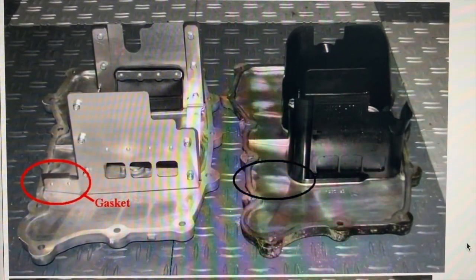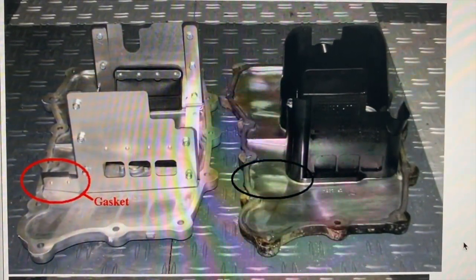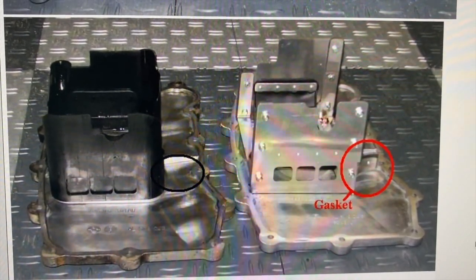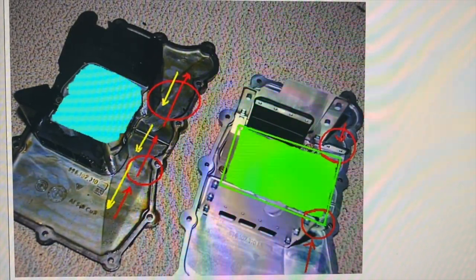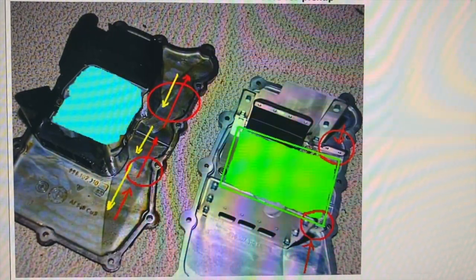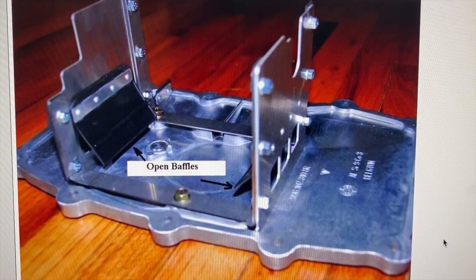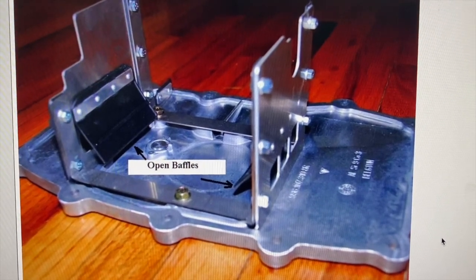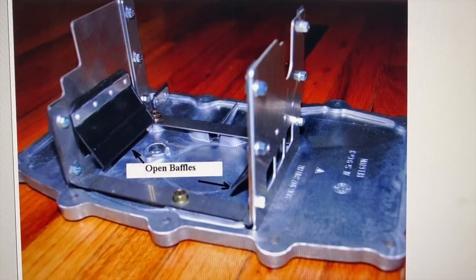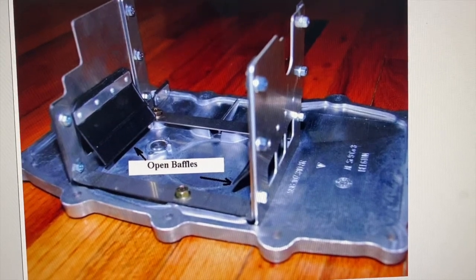Let's take a more detailed look at the differences and why you might want the X51. The X51 has small upright gaskets that the stock one does not have. When you put the pan on, these seal up with the engine block and prevent oil from flowing around the baffles. This effectively creates a little pocket of oil that remains close to the oil pickup, since it can only flow through the baffle openings. The baffles stay open so that oil from the returns can flow into the baffle interior, but lateral Gs causing backflow will slightly close them, keeping oil inside the pocket. With all of these things combined, there is a larger quantity of oil at the pickup that will stay near the oil pickup longer under cornering. So although a complete oil scavenge pump may be the best solution, the X51 pan looks to be much better than stock.